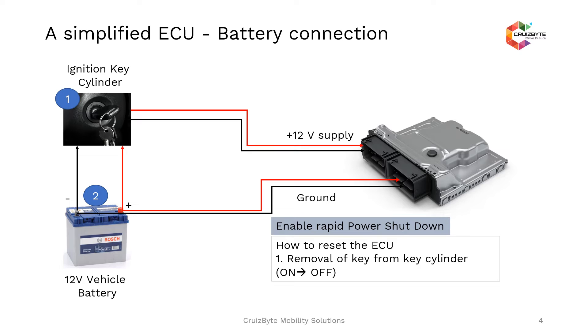Most modern ECUs have this kind of connection because many times ECUs get woken up through external triggers, through CAN signals coming on the bus, or when you receive an unlock signal remotely from an RKE or PKE system. Without the key being available in the vehicle, the vehicle will get prepared for some of its activities — like authenticating the key remotely or turning on the engine remotely.